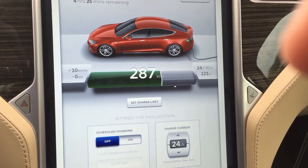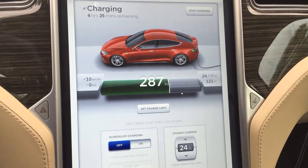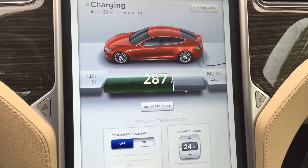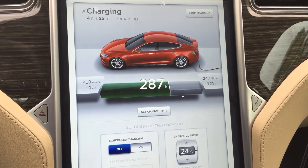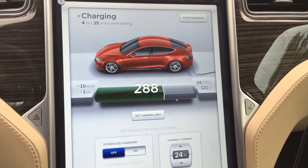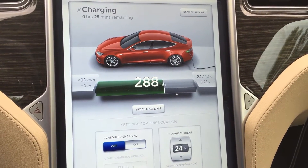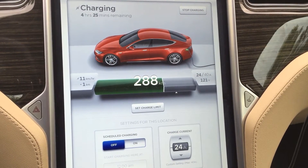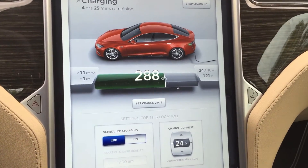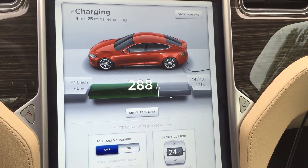I have found that when charging it takes upwards of 15 minutes to get up to its full actual charging speed. So in a case like this where you're using the TT30 connector, it's one of those times where you might not have many choices. You're in a small town, there are no public EV chargers, maybe you've got to hit up a campground or something — maybe it's an emergency and you just need a little boost to get to your next town. Being a 30 amp connection, this is about double the rate of a typical 15 amp household circuit.